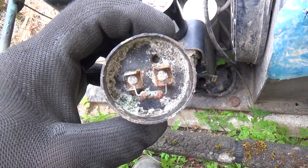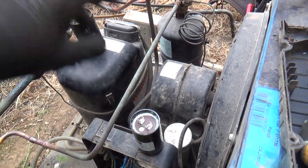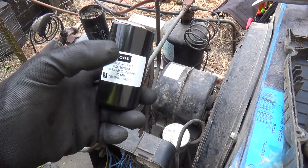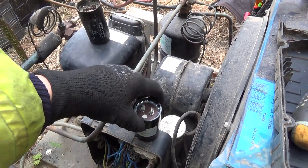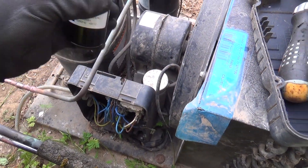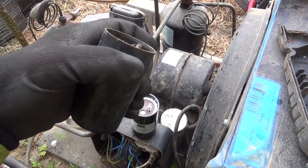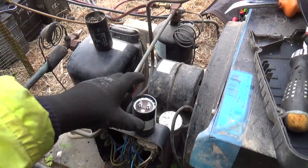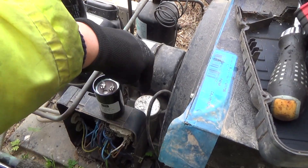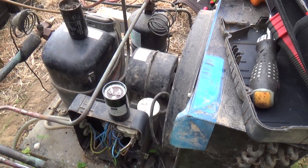The top of that's horrible - it's blown the little vent plug out. That's a 100 plus 20, so it could be a 120. The nearest I've got is a 130 (108 to 130 range). I'm not going to worry over 10 microfarads. That's reading 114, which is in the ballpark because that would be 120 max. And this was reading 20. The 35 run cap is still reading good. So we'll put that on and hopefully she'll start up.